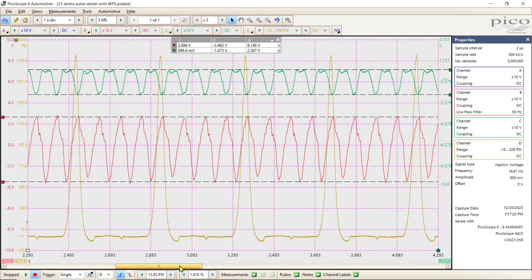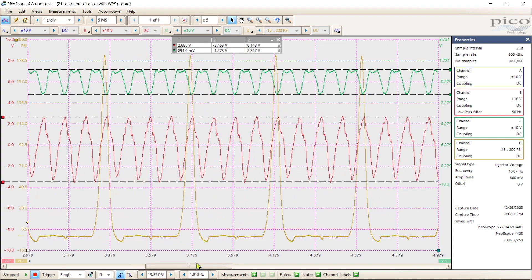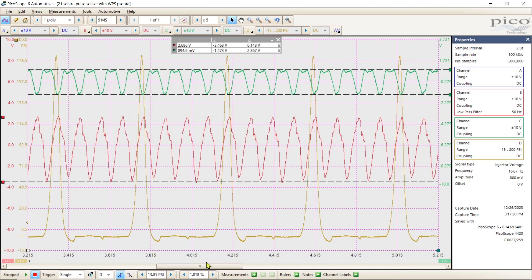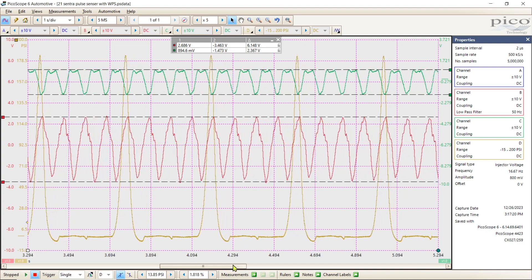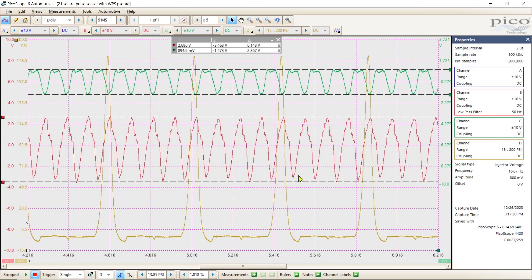Approximately 13 minutes went by from the good to the bad capture. All I did was put a WPS in cylinder number one — and that is creating what appears to be an issue on number four. That's number one's companion cylinder; the firing order is 1-3-4-2. I have theories on why this happens, and I think it has to do with crankshaft speed and the added volume to number one because of the hose. To me, this is a false reading — I would chase this if I didn't know the WPS was in there.